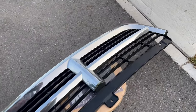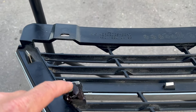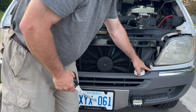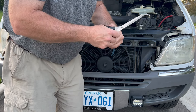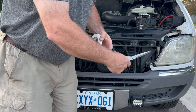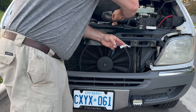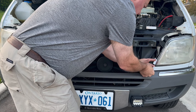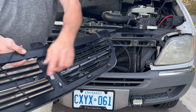Let's take a look at our grille and our fix. I painted this a bit so it doesn't look so white — if you look inside it's incredibly white, but from the outside you can't see it at all. For assembly, I want to put a little piece of white electrical tape over here to address the paint wear from vibration. You cut it — you don't rip it — and put it down about that much. To make assembly easier, I pre-installed these screws; you can do that because there are slots on the bottom.